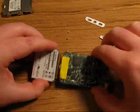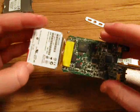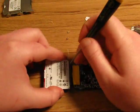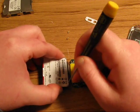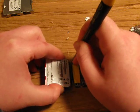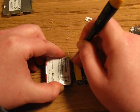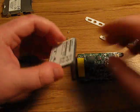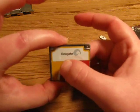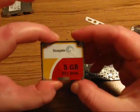Now we have the motherboard and hard drive assembly. To remove your hard drive from the hard drive connector cable, gently apply pressure to the edges of the cable a little bit at a time, and grasp your hard drive on the sides to reduce pressure. The last thing you want to do is apply pressure in the middle of your hard drive, because you'll smash the disk inside and you'll definitely have damaged it.